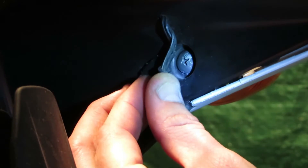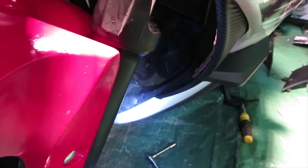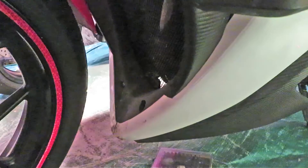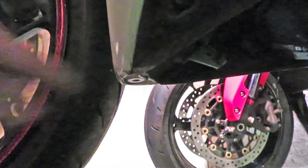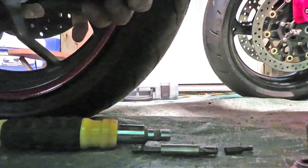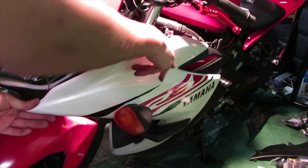On your bike you may not have LEDs here so you'll find this screw fairly easily - it's towards the top where the headlights are. After removing all those screws you'll be able to remove the whole fairing. You may have to do some wiggling. Move the plastic piece forward carefully, then pop it out - just be careful with the tabs. If the plastic screw is difficult due to dirt and grime, you can use needle nose pliers to pop it out without breaking it.